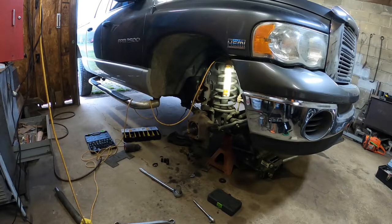Okay. Well, I got a little bit of this in time lapse. I got the ball joints tight, cotter pins in them, grease fittings in. I slid the axle shaft back in and put the wheel bearing on. Put the ABS sensor or speed sensor or whatever it is, with a new wire on that, put the brakes back on, and get this side wrapped up. As late as it is, I'm just gonna wait and tackle the other side tomorrow. So we'll make this the last video on the truck. Hopefully the next time you see the truck in the video, we're gonna be hauling farm equipment home.